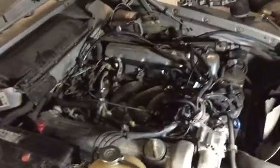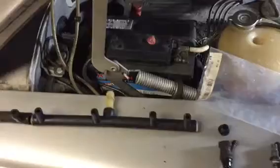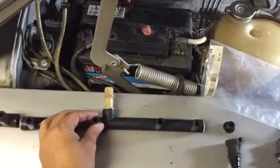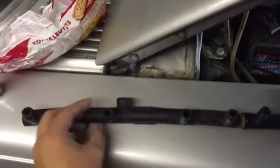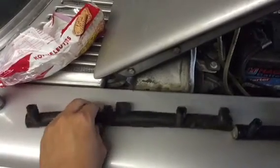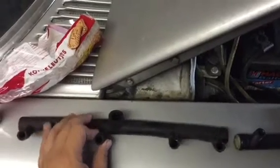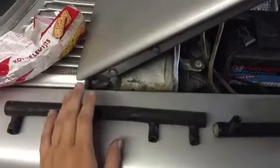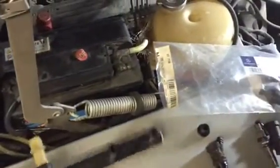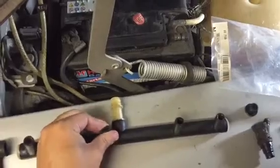The Mercedes vacuum system uses vacuum tubes — here is a new one; you can see the rubber is still flexible and the diameter is smaller than the one I've already disassembled. The old one is hard, doesn't flex anymore, and is bent out of shape. This also goes for the supply line — this is clearly not usable anymore, and this is one of the reasons you get false air and elevated RPM. I've taken the old plugs out and put in new, more flexible hoses that will close off any air leaks.